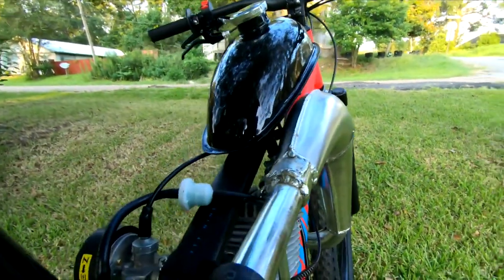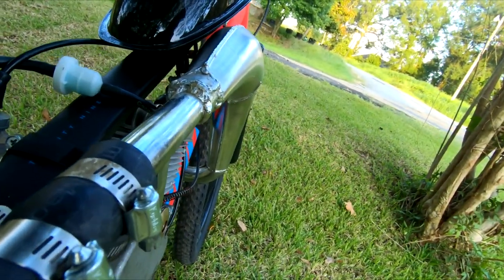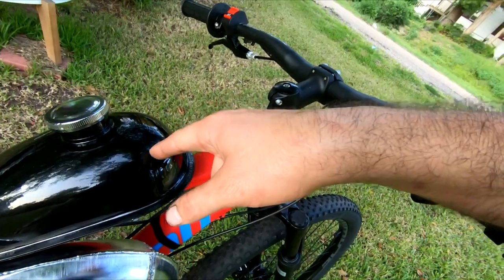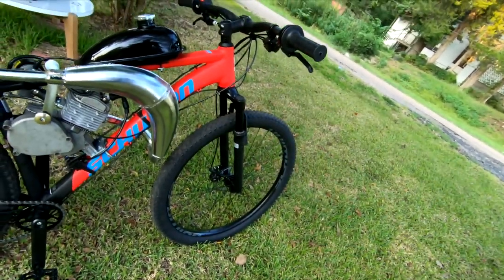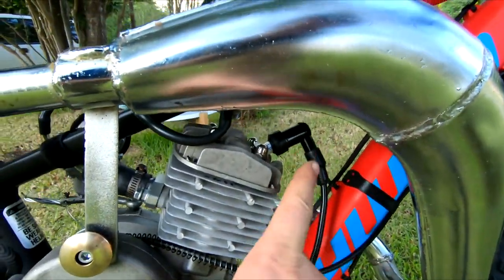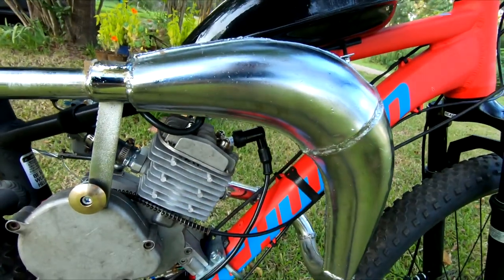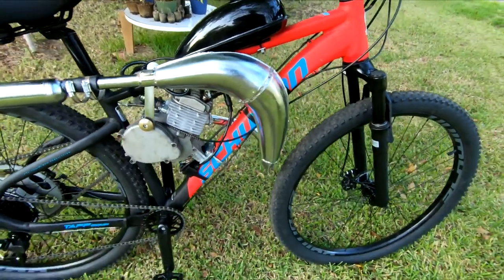Up here, the mounting plate for the gas tank pushes up against the pipe, which prevents it from contacting the tank. This exact spot on the frame — literally to the centimeter — is the only place I can put the tank to clear the pipe. It's almost like this bike was designed for it accidentally. The motor also limits your options because the spark plug has to come out the front, so single jugs like the YD100 or the Phantom 85 won't work unless you plan on removing the plug, filling in that hole, and drilling and tapping your own — an interesting concept, never tried it.